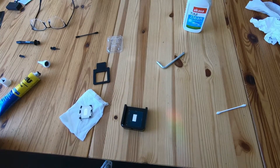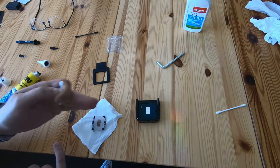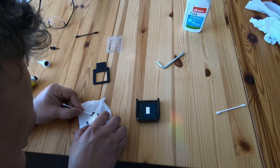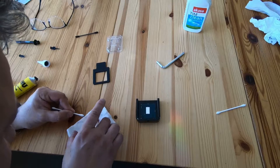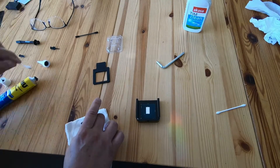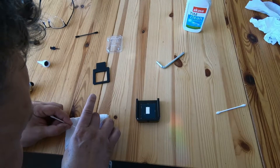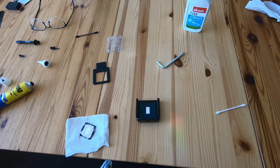I've put the liquid metal on the die and also some on the lid. I taped the lid this time — that was easier to get the rectangle shape. I've applied some of the silicone glue to the edges and I'm spreading it around so it's even. I don't think you need to be particularly careful, but it is important that it goes into the corners. Cotton buds are a bit naff for glue spreading — I don't want to use the nice applicators that came with the kit.